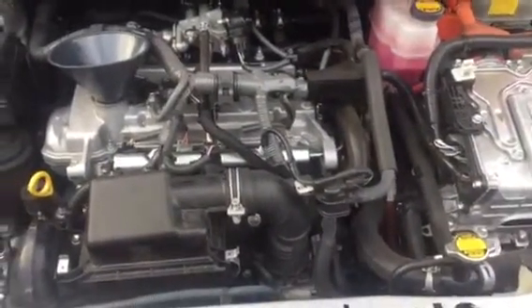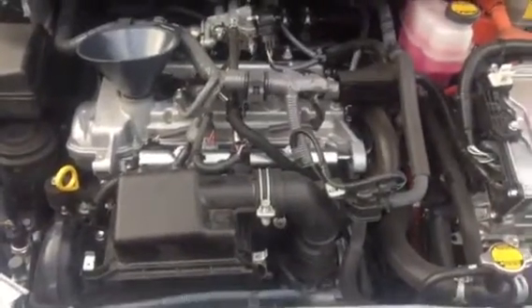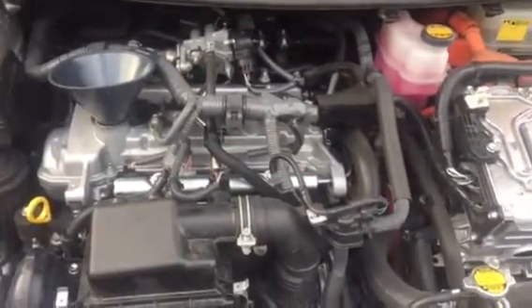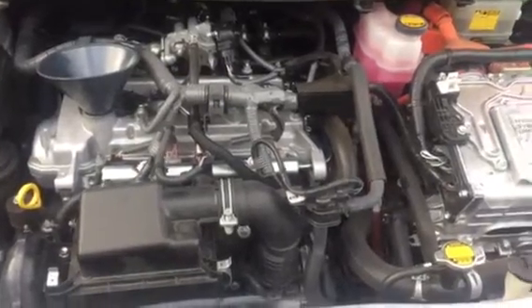That's about it — it's super easy. Install the new filter, put in the new oil, and your Prius is good to go for 10,000 miles. One important thing I should mention: the oil change interval on these Priuses — and pretty much every hybrid vehicle — is every 10,000 miles, not three or five thousand. So yeah, guys, there you go.